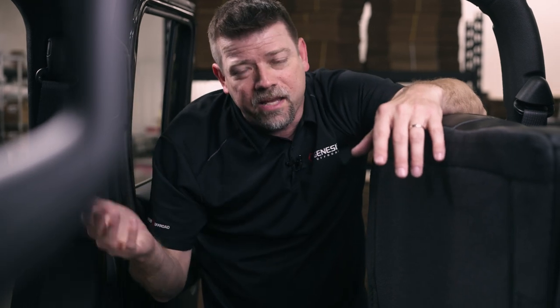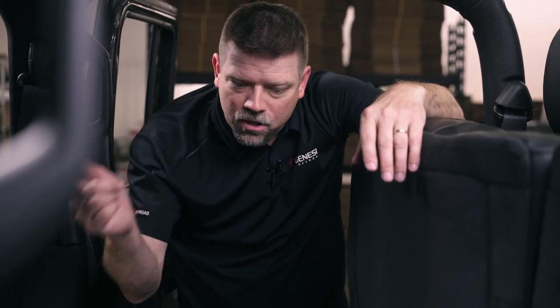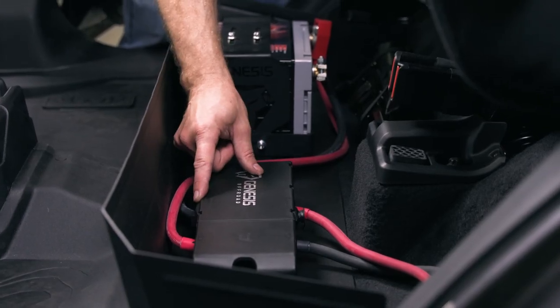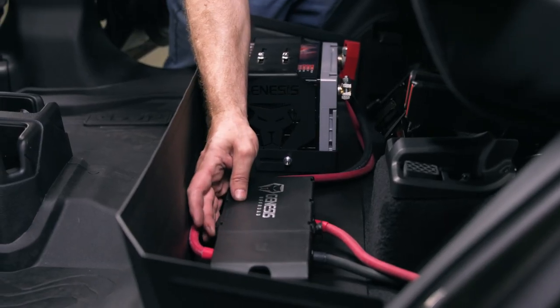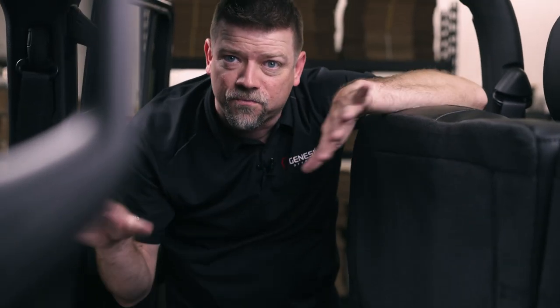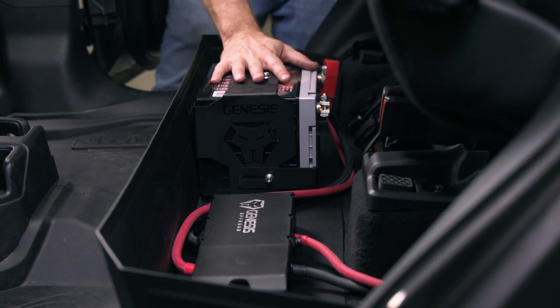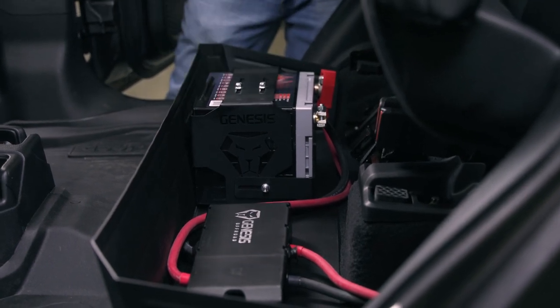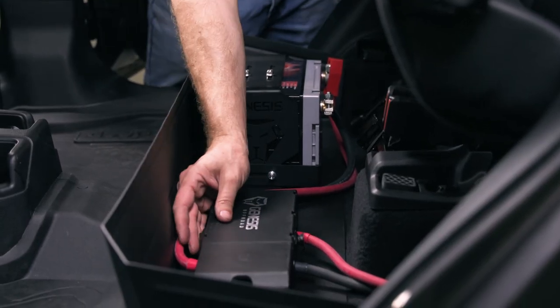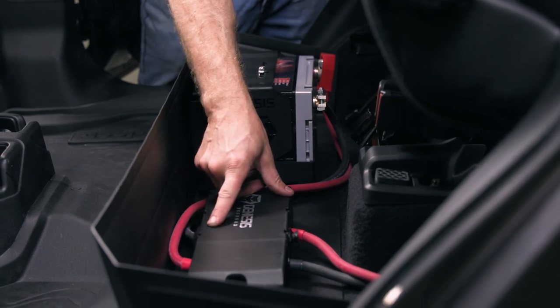So that's the whole idea of our system — we want to make sure you can always start the engine. Now, if you hop in and your cranking battery is too low for whatever reason and you can't start the engine, you can reach back here, reach under the seat, and hit the boost button right here — change that to on — and that will jumpstart you from the power in your second battery. Now, if you need to manually separate the batteries, you can do that also — just flip the switch the other way to the off position and that will leave the batteries separated from each other. That means you can run everything off of here and it will not touch your cranking battery. But also while it's in that off position, your engine will not be charging this battery, so just be aware of that. Usually you'll just leave the switch in the auto position in the center. So that's our dual battery system remotely mounted under the back seat — fold our seats down and you don't even know what's under there.